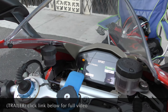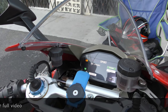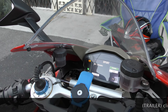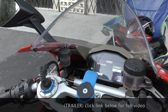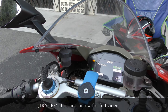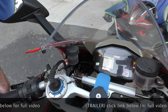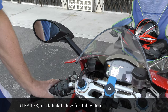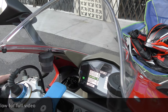If you look at the dash, you can see 'Dynamic' — that's what the computer is giving you. We're going to take the computer out of the equation and go to Fixed mode, which gives you much more control over the way the bike rides. Now we can choose whatever we want: compression, rebound, front and rear, plus your steering damper. Rear compression is 18 — the smaller the number, the firmer it is.